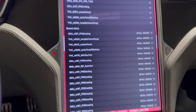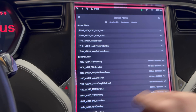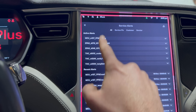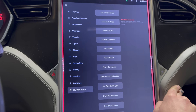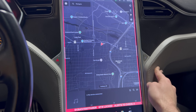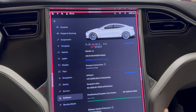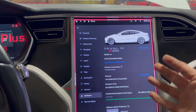Our screen is fully booted up. In the service alerts tab, all we've got is battery heater related stuff, electric power steering assist — that's just normal faults for these early cars — and MCU1 FPS crawling because the frame rate is not having a good time on it. We can go back to our software tab and you can see we also get P100 there as well. Simple as that — that is a 100 kilowatt-hour pack swap complete.